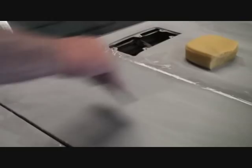Okay. Now that I did that, I'm flipping my block over, and now we can go ahead and block that out to the nice finish that we need to do what? To sand it. To paint the car. Yeah. We're going to take our squeegee, and as you can see, as I squeegee it out, you can see that that is a nice mirror finish sand job that I'm coming up with, and it didn't take me long to do that. Why? Because you're doing it right. No, because we already went over it with 180, and sanding it with the 400 should go very, very quick.